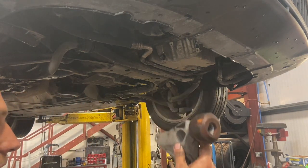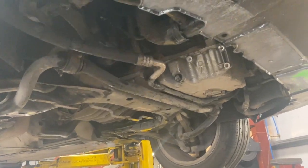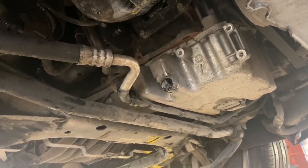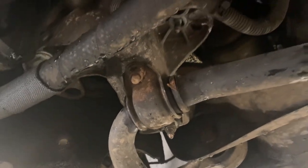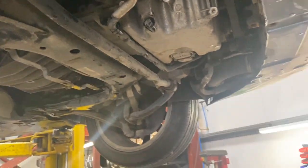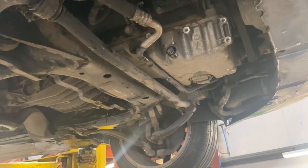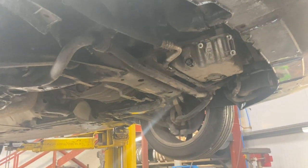That's the engine mount release now from the front. Yeah, and the engine mounts are loose now, and we're just winding up the thread on the engine crane at the front to see if it starts releasing it. It starts pulling the engine off the mounts. Yeah, it's coming. And it is just starting to take the slack there, so we know that when we drop the subframe, it's not going to drop down all of a sudden.